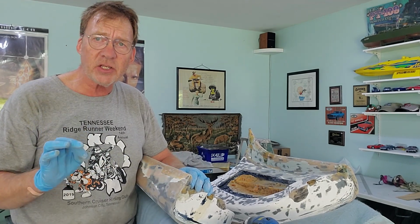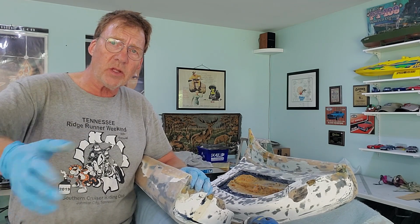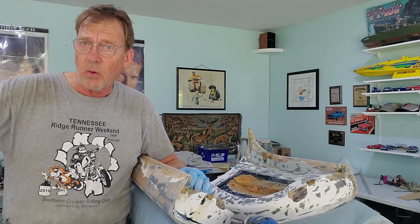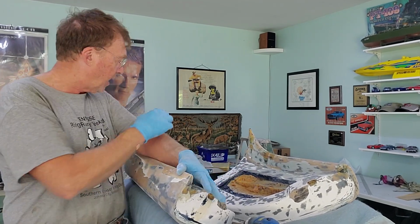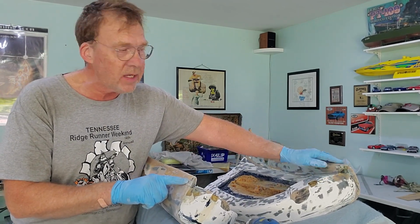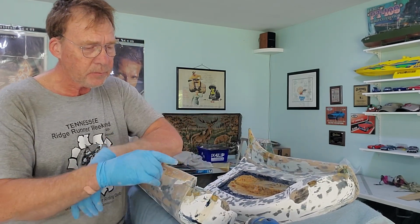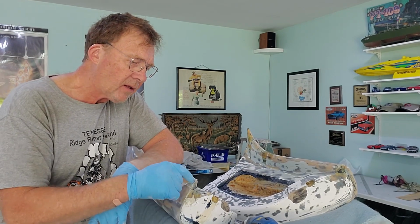And remember, these hinges are bad. These hinges allowed this door to torque, which means when the door opened and you leaned on the door, it would move. And if you would go close the door and the door wasn't aligned properly, well, guess what? You take the corners out of the top and you take the end off of the back. And you can see on the left door, the passenger door, this edge here comes right around the corner. This one, as you can see, is gone. I think that in a collision, this broke and that cracked the door.